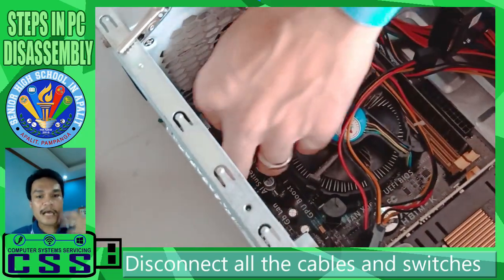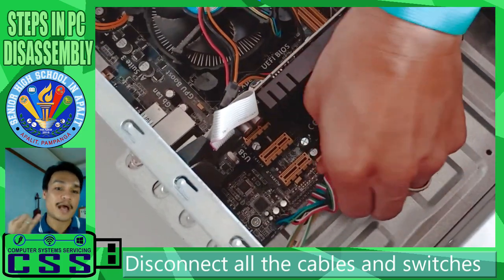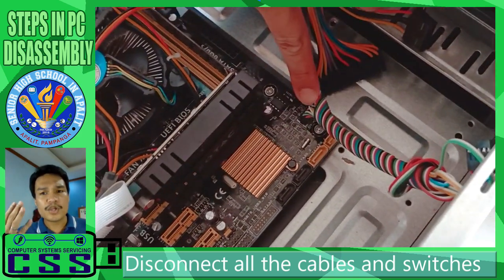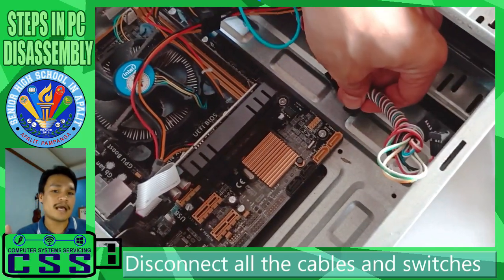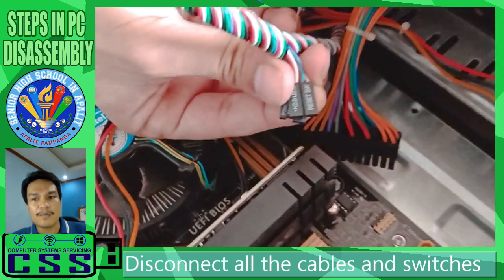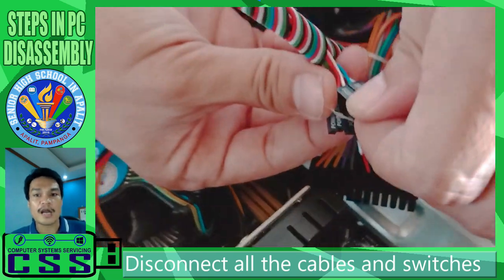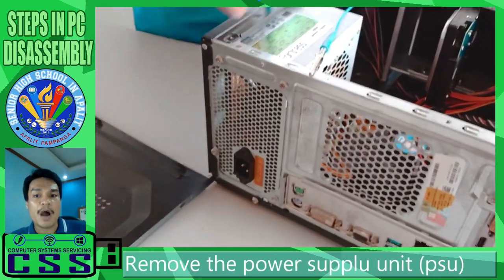Okay? We will also remove the switches: the front panel switch, the power switch, the reset switch, and then the audio and USB connection on our front panel. So we remove all of those. We have to make sure that all cables and all switches on our motherboard and on our disk drives are disconnected. After that, we are now ready and prepared to remove the screws of the power supply